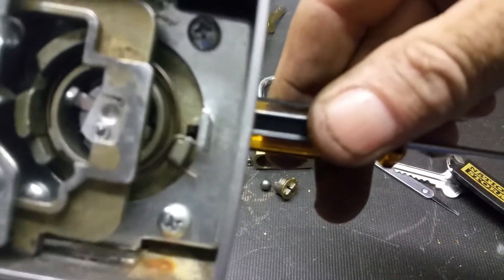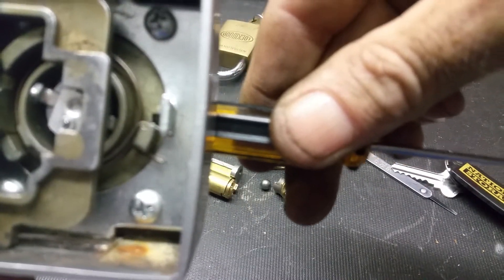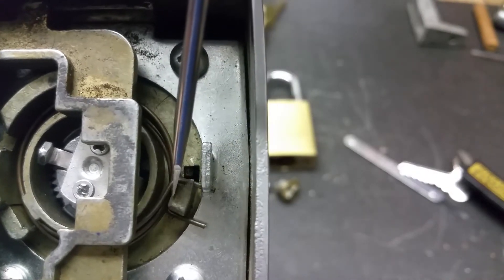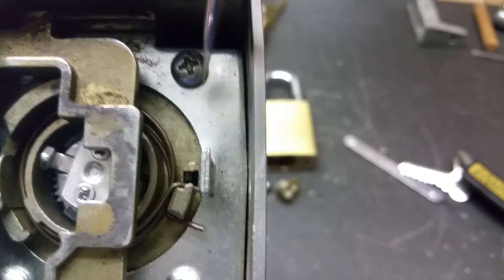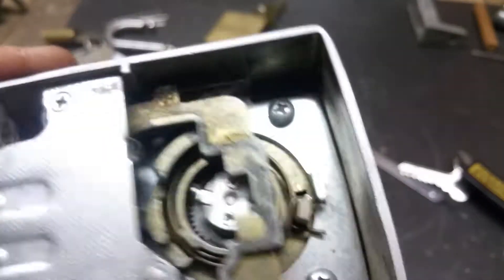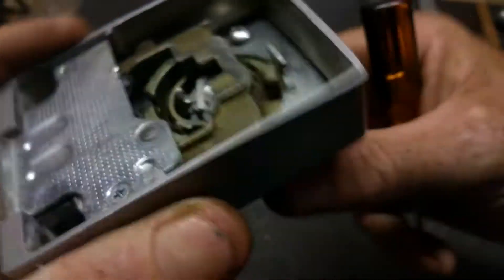That still works to a point - you still get a bit of spring tension, that's why the handle is in that position as opposed to being in the correct position. So yeah, pretty confident if you change that main hub return spring and the backing plate, I think most of your problems will be sorted with that one.